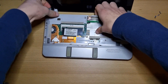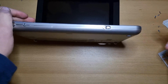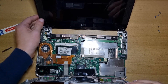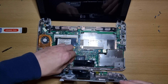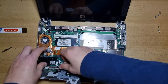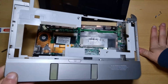Now you can remove the whole palm rest. Be sure to also remove these two things from the side — this little caddy and the SD card holder, or SD card dummy. Then you can lift this out. Be careful, because there are still cables attached under here: there's one right here, one ribbon cable right here, and one more cable here. And then the whole top cover comes right off.